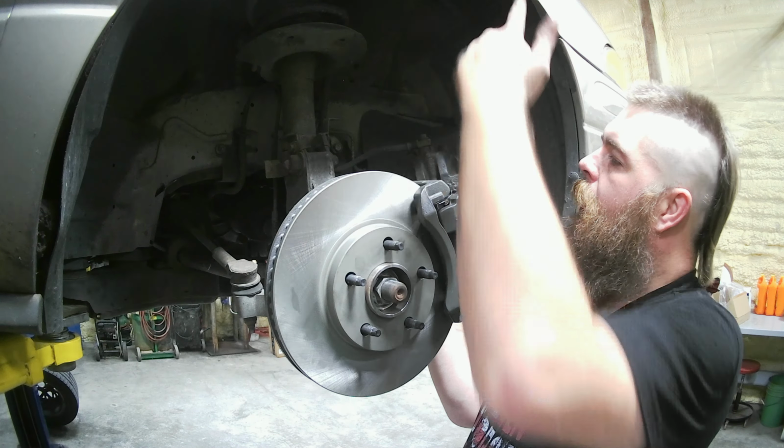Now we're going to go ahead and do a little bit of a gravity bleed, then we're going to do a power bleed. You got this handy dandy tool right here. Hook your air in right here. Flip it on, and it'll start sucking. So what we're going to do, we got this attachment. It's good for pulling out coolant or anything. But as you see, that right there fits on the brake bleeder, and that'll suck that fluid and air right through there.